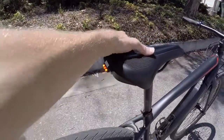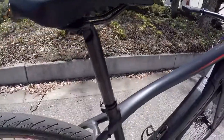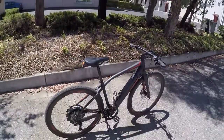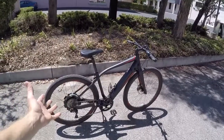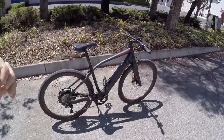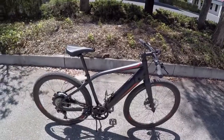It's one of the things I've heard people ask about. It's like, oh, I want to change the saddle. It's actually a really nice saddle, but it's sort of all wired in. So the seat post here, I think, is 30.9. And you could update this. You could get a suspension post. In fact, the Turbo X for 2016 does have a suspension post built in. It's a proprietary, specialized design. Really cool, but for road riding, this is a little bit more aggressive. Definitely, you're leaning forward more, and that kind of thing is going to add weight too.